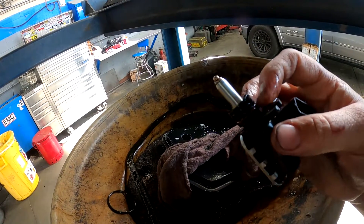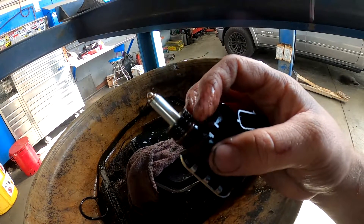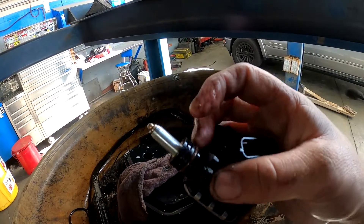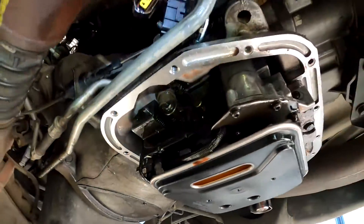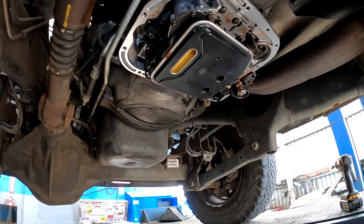The neutral safety switch does have a sealing O-ring. Anytime there's an O-ring, make sure the journal it rides in is okay. The new one comes with a new O-ring already pre-installed, so just pre-lubricating it, torquing it down, and making sure it's engaged is all you really need to do. Now let me go get the pan out of the hot tank and get it all torqued up and ready to go.